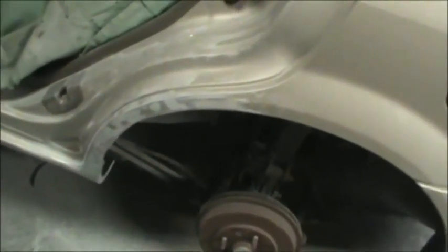And that was mostly pitting, so we use short strand. We'll clean it up with naval jelly and use short strand. And inside here, on each side, we're actually going to use undercoating on the inside — we've got to seal it up. We're getting there. Fiberglass on, mud coming next. The inside is all seam sealed — we're ready for undercoating. Got some mud going on.